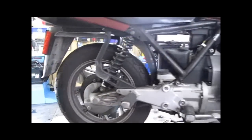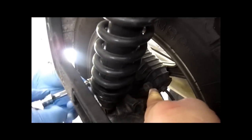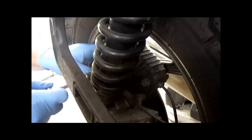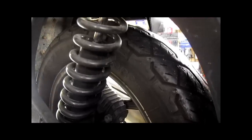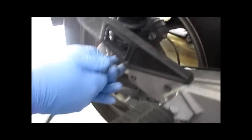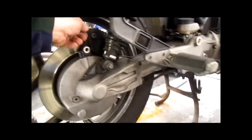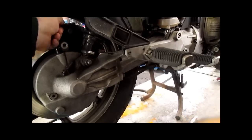The first thing you want to do is remove the saddlebags. Your next step is going to be unbolting the caliper. You need an 8mm Allen wrench. There are two bolts. You see this bolt here — don't touch those. Those hold the two caliper halves together. You want the mounting bolts, not the bolts that bolt the caliper together. So we'll remove this bolt, we'll remove that bolt. Now the caliper is loose, it can be lifted up and down.